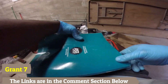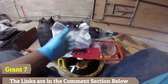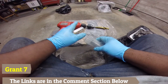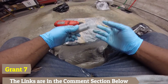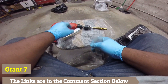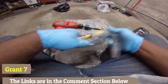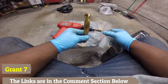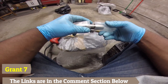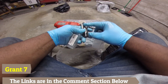Some people don't bother with this modification and just splice wires — we're not doing that. The fix is relatively simple and you don't need much. You need a three-quarter-inch drill bit and a seven-eighths-inch drill bit — I'll link these in the description below. Then you need a three-quarter tap with 14 NPT threads — that's what cuts the new threads so you can thread the new switch into the case.